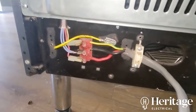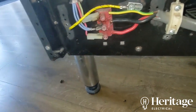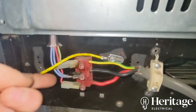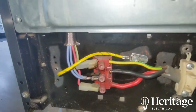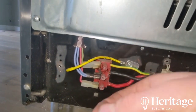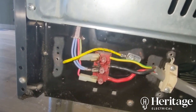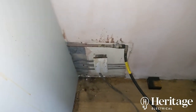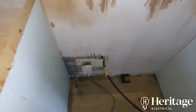Taking the connection plate off the back, you can see what's left of the little plastic boot around the neutrals — there's a lot of heat damage there. Looking at the connector and cables going into the oven, they seemed okay initially, but on closer inspection all the terminals were loose — the neutral almost pulled out. Giving those a really good tighten-up, that's most likely the cause of the overheating. Someone else might have just tested at the connection plate, but we always go the extra mile and test right up to the actual current-using equipment.